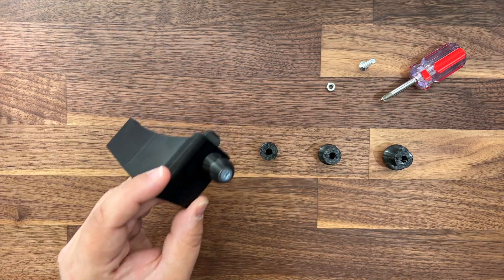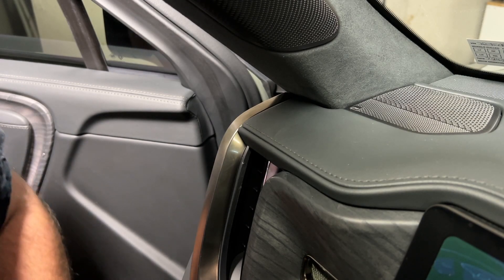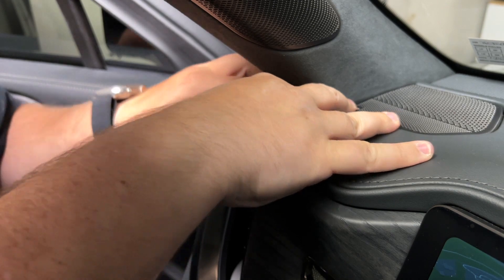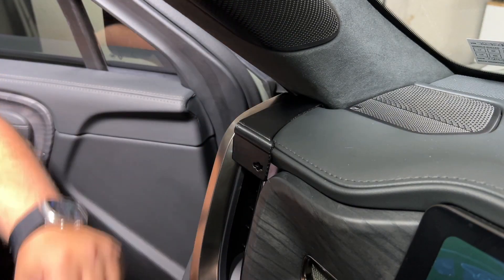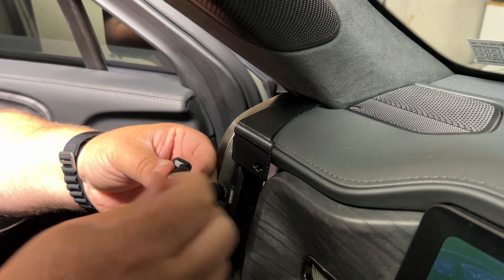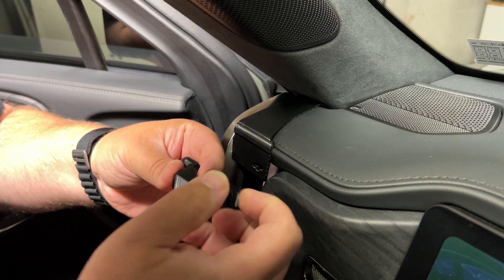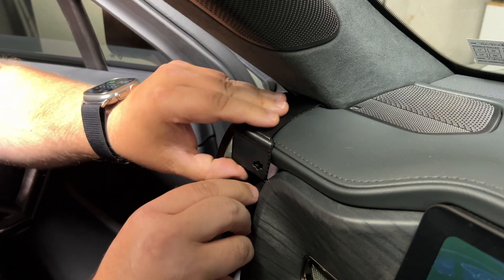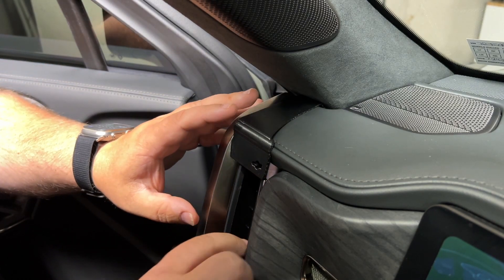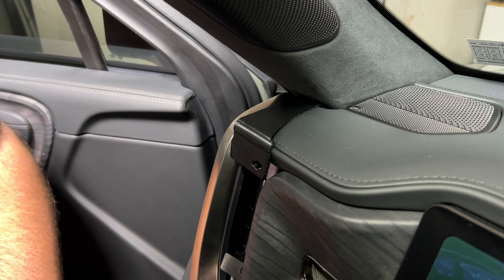So let's go take a look. The first step is to insert the upper portion — I find pushing on the A-pillar trim to be beneficial. Next is the plate: insert the nut into the opening, rotate it about 45 degrees, move the upper portion out of the way, and insert it behind the trim in front of the vent.